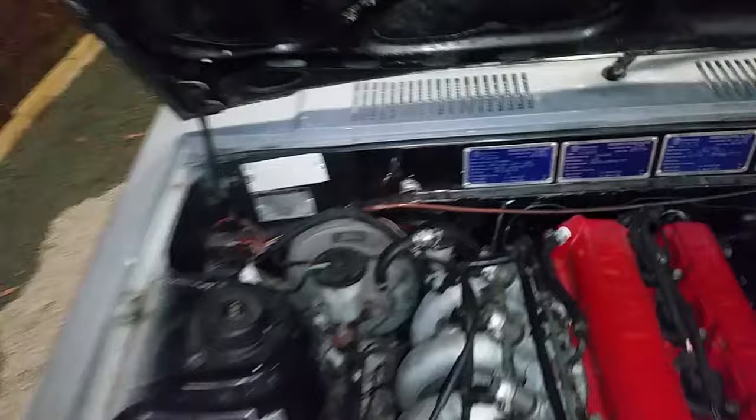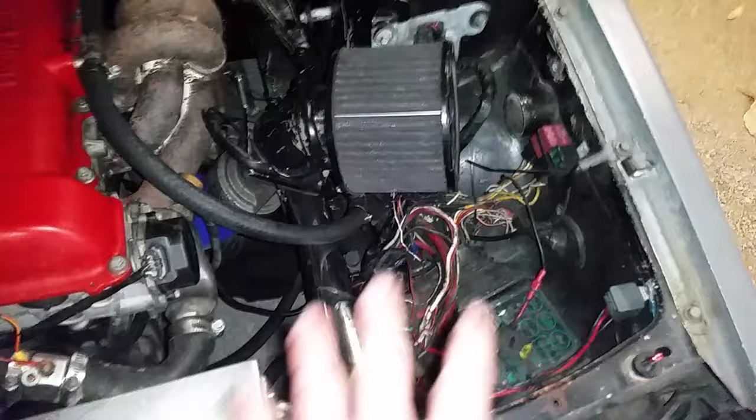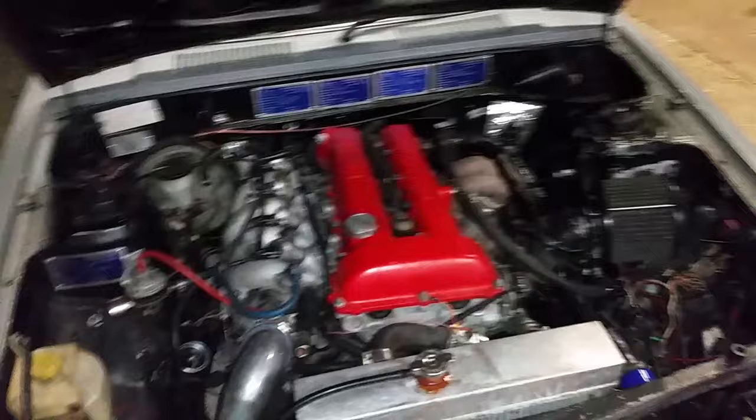It never had a one-way valve on the brake booster, which meant whenever you hit boost your brake pedal would fly back up at you if you were trying to do a burnout - that was terrible. So I put a one-way valve on and it's working a charm. There's a bunch of wiring I want to get rid of - I've been looking at where to wire the dash in because the previous owner just threw the loom in really haphazardly.